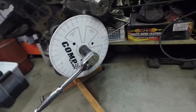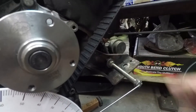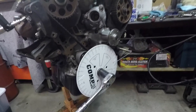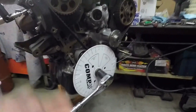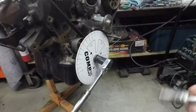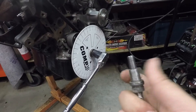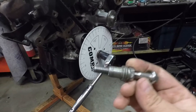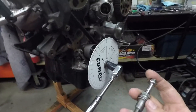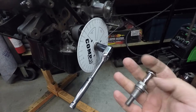I also got a degree wheel here. My mount just went into a motor mount with a spare bolt with a jam nut, so I can lock it in exactly where it needs to be, and weld it on a piece of rod. Now, finding exact top dead center — these have a mark on the oil pump versus the crank gear, and that gets you pretty much where you should be, but just out of precaution. Thunderhead 289 on YouTube came with a great idea: old spark plug, broke out the guts, tapped it, and put a bolt in it. This is a spare bolt — I think it was for a 350 water pump or something like that. My brother wound up getting extra, and I actually had to cut it up higher because it didn't have nearly enough threads.